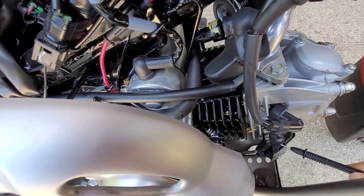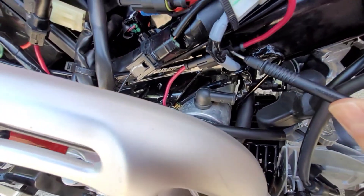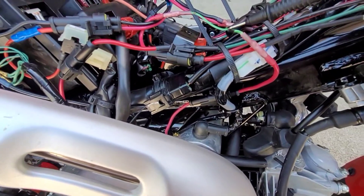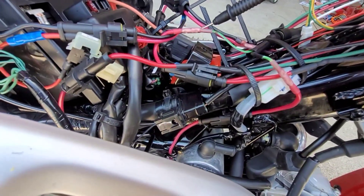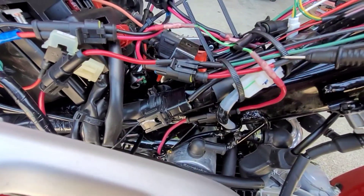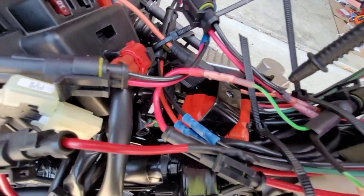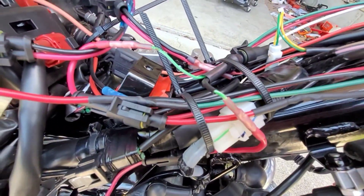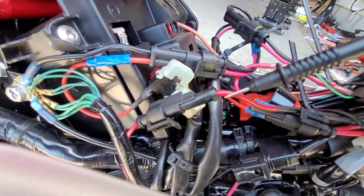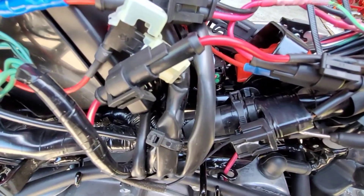Here's your O2 sensor right down here. The wire comes up along here, follows up here. Here's my first connector — this goes around here and connects into the unmarked side of our AFR meter. The return line, which is the marked side, connects here, follows around, and goes to the white wire on the FE device. That white wire comes around here to the back side, straight on into the actual FE device which is right down here. Then the green wire from the FE device comes on out, comes around here, back around, and into the original plug that goes into the ECM — so that's circuit one.